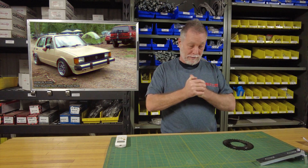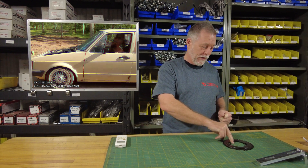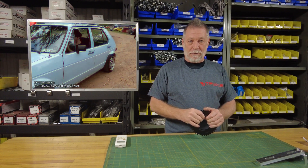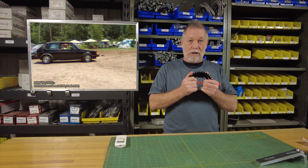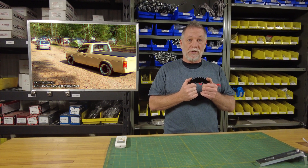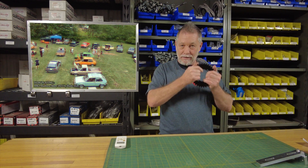Welcome back to Tech 53. I don't think many people know about this product. Using a standalone ignition system, this 36-1 trigger wheel gets used with the EDIS 4 ignition system from Ford. You get all the coil packs and everything else, and run the MegaJolt or NoDiz from the UK, and some other systems that could probably run that as well.